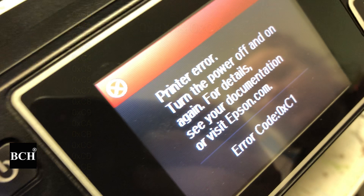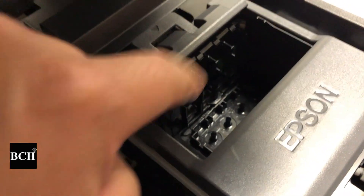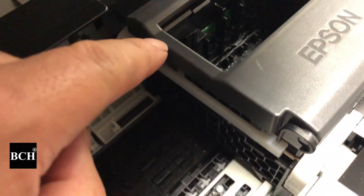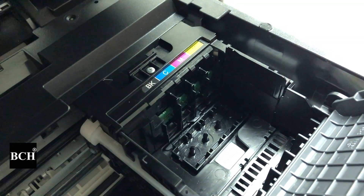They're all talking about the same thing. Basically, the printer cannot read input from your CSIC board. The CSIC board is a piece of board behind the cartridges. The cartridge chip information gets transferred via a CSIC pin, and the CSIC pin connects to the CSIC board.